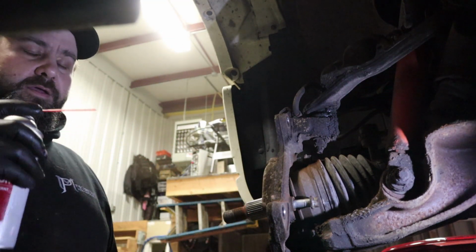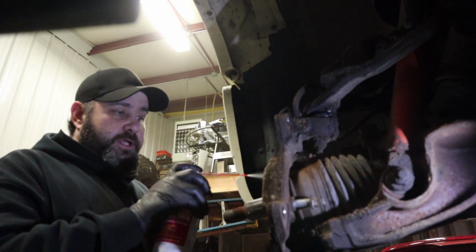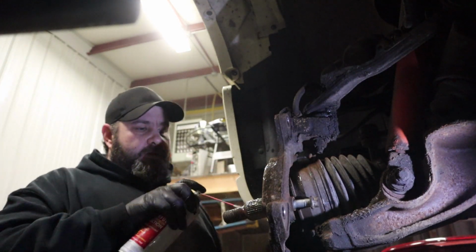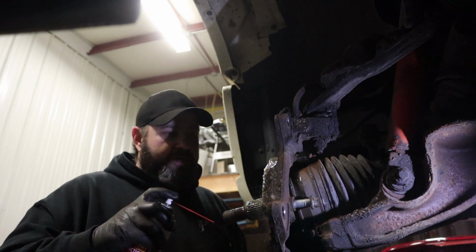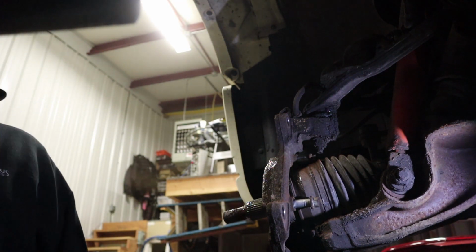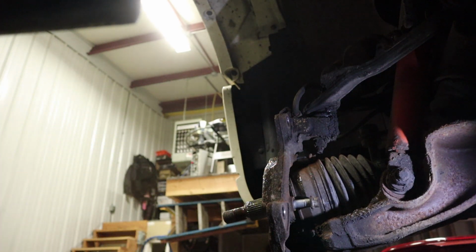fluid film. Fluid film is a nice, non-toxic, lanolin based coating. It seems to work really, really well in Connecticut when it comes to an anti-seize agent. And the best part is, when you get it all over yourself, it comes off. Unlike anti-seize, which ends up all over the place, this stuff sprays on and kind of sticks where it's at.